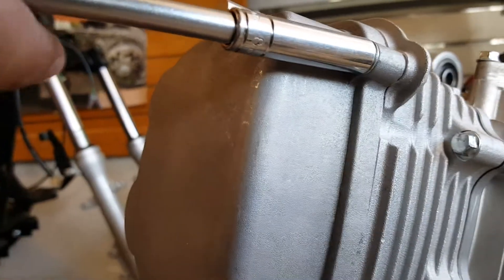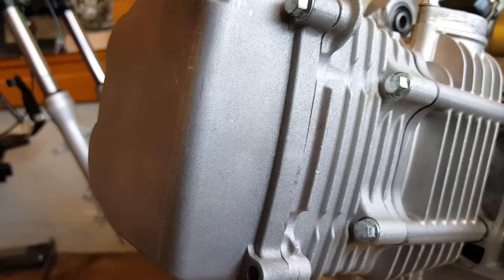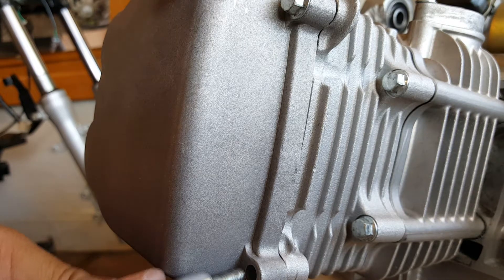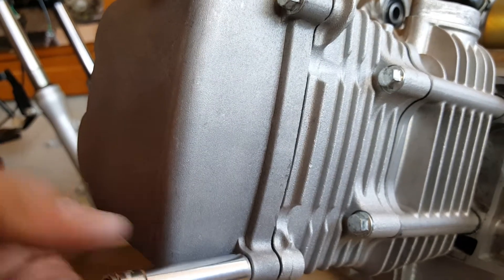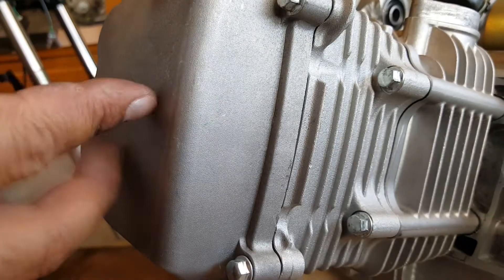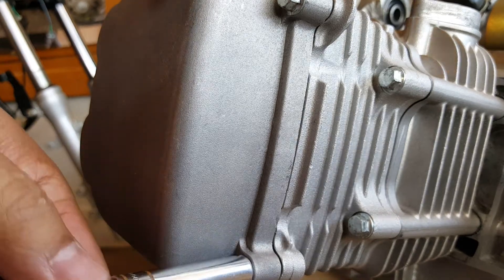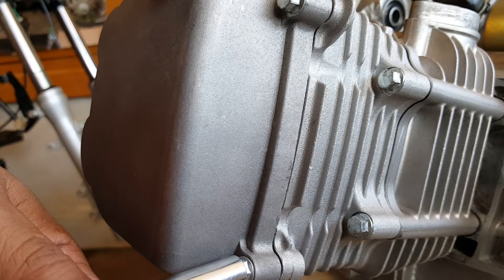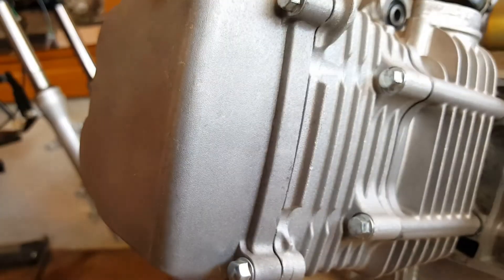So there we go, all this is done. We're just going to seal everything back in and we are done. We torqued all up to specs, we changed the cam gear. We also put the new Tata rocker arm. I also have the Tata valve cover as well, but we'll use pretty much the original. The valve cover is not going to gain performance I don't think, but it does have a better gasket on the inside. You can see here — Tata makes it much more quality. They actually have a gasket inside their valve cover on their head.